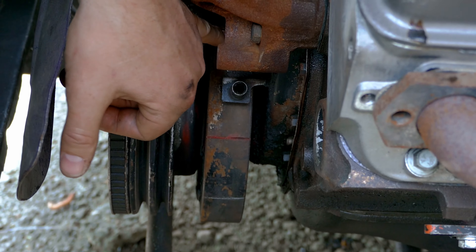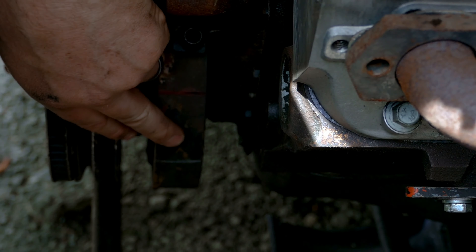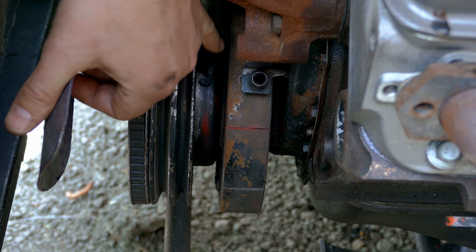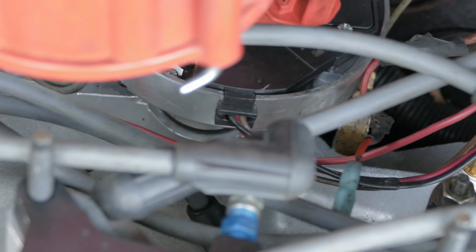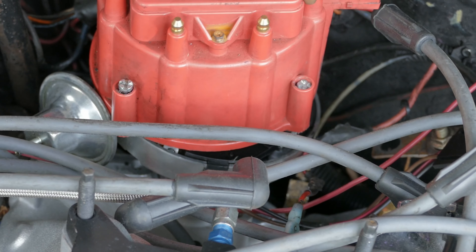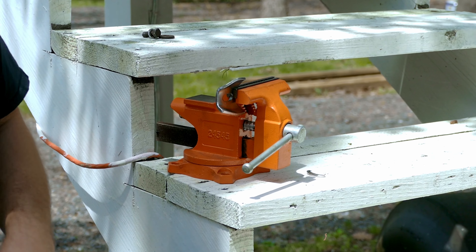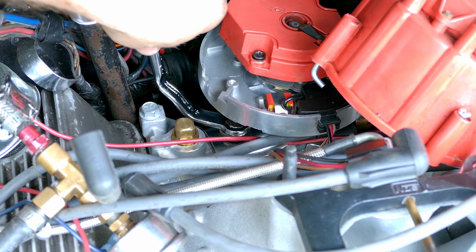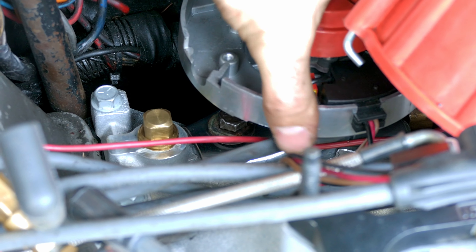Now remember, my timing light is not adjustable, so I can't dial it back. That's the reason why we had to put some line on the balancer to get some reference where it was advancing and retarding. The next thing I had to do — I had one of those cheap distributor clamps and it wouldn't fit correctly on the driver's side. So we went over to the passenger side, but it was binding up on the plug where that intake had revisions for water passages. We had to cut the distributor clamp so it would fit on the passenger side where we could actually lock down the distributor. Eventually I did end up removing the vacuum advance on that distributor because we couldn't get anything on there to tighten it down. So we locked out the vacuum advance.